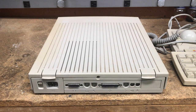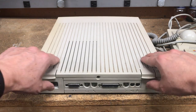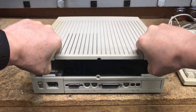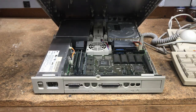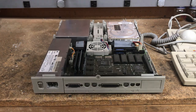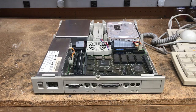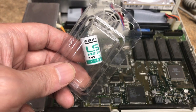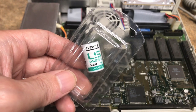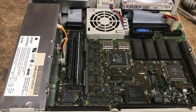To remove the cover, all you have to do is lift up on these two tabs, rotate it forward, pull it out, and move it up out of the way. Put the lid in a secure location. The replacement battery is a 3.6-volt lithium half double-A PRAM battery, and the location of it is right here on the board.